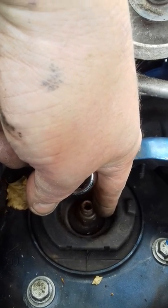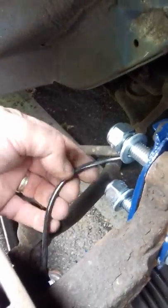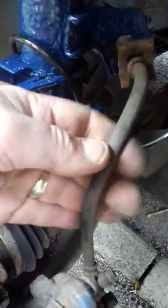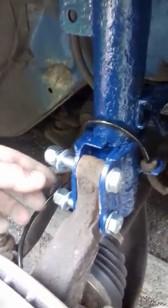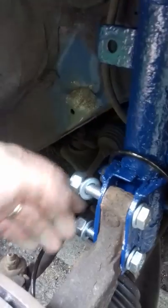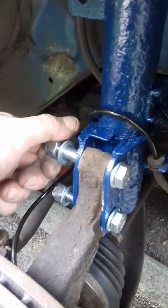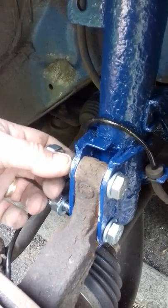Remember: cable ties for getting those clips out. If you're grinding near the bottom, be very careful not to clip the ABS hose or the brake hose. Don't forget to undo the suspension link — to reconnect it afterwards you'll just have to jack the hub up to get the two in alignment and then lock it off. Check the manual if needed, but I'm using aftermarket high-tension bolts here — not ordinary bolts — which are considerably cheaper than genuine Nissan parts at five quid a shot.